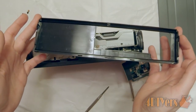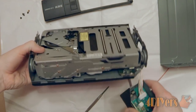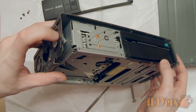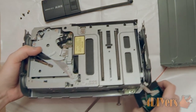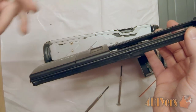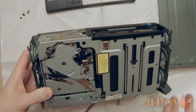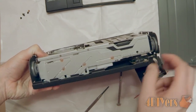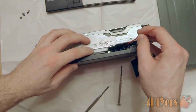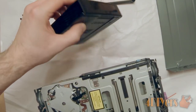I've removed the face first because it's easier to work with and I can get behind the mechanism. It has two snap clips — one on each side — that snap into the framework with rectangular holes. If the sliding cover pops out, just slide it all the way to the open position and snap it back into the rails. To remove the stuck cartridge, stick your finger inside — there's a little black tab in there. Simply push on that tab and the cartridge comes out.